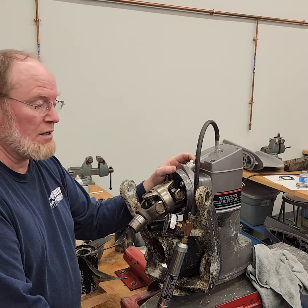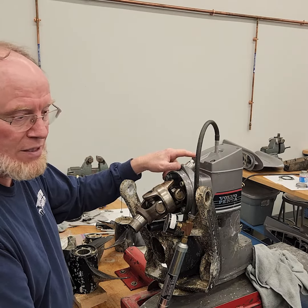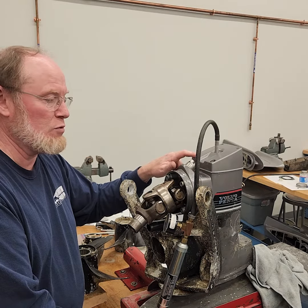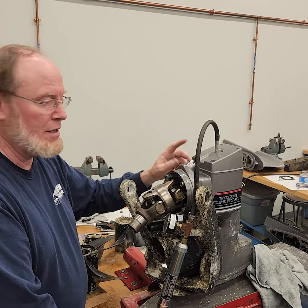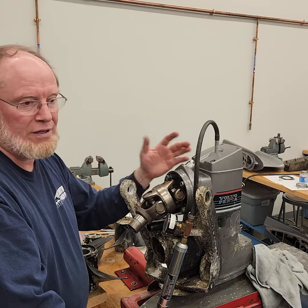As I showed you, this failed a pressure test. If I had only done a vacuum test, it would be very hard to detect that leak — I'd have to put my finger there and hold it for several minutes to feel the vacuum being drawn in. It's much easier to see the air leak out under pressure.